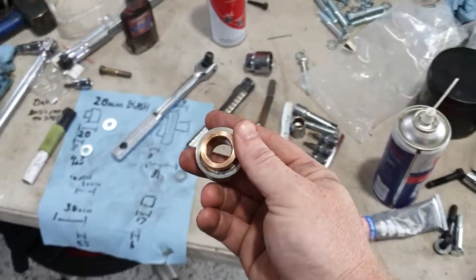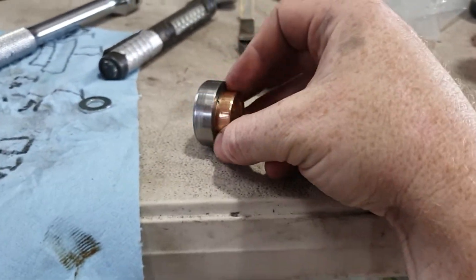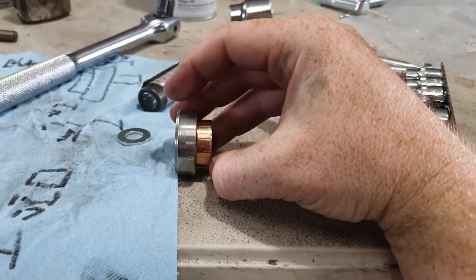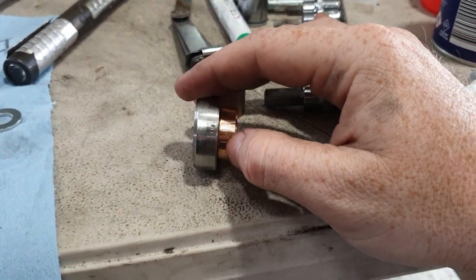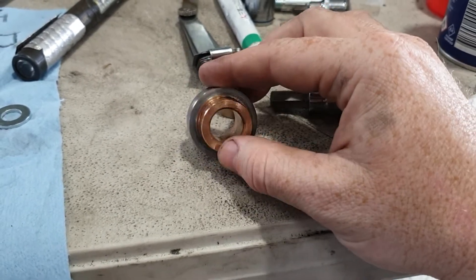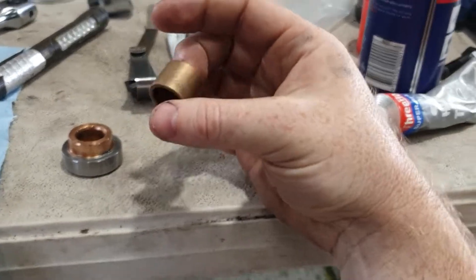So what do you do? I called up Delos Conversions and we confirmed the different gearbox types. They offered to make me a custom bush, but unfortunately what I would effectively have to do is remove 10mm of material. As you can see from my measurements, this is 20mm overall — so we're effectively cutting it in half, which only gives 10mm engagement on the spigot bush. I just wasn't happy with that. So in comes the stock SR20 spigot bush.